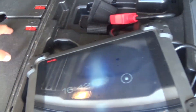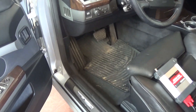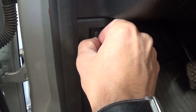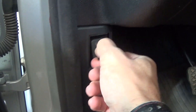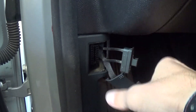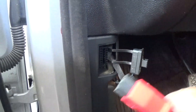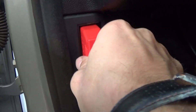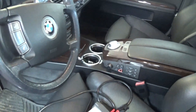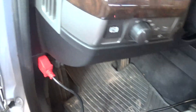We're going to connect it now and see what's wrong. What we need to do is locate the OBD connector — right here. We need to pull the cap off, just like that. We have enough room to plug it in, and next we connect the cable. It goes only one way, and you can see the communication lights here.